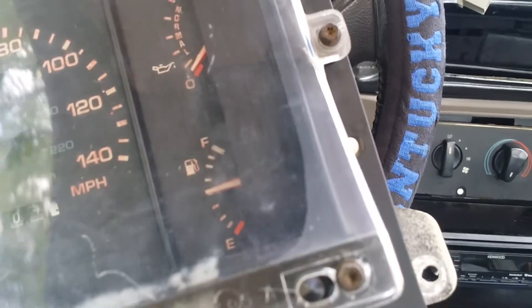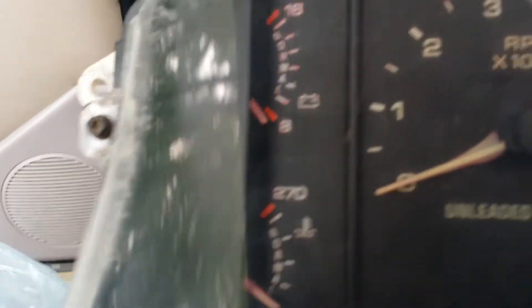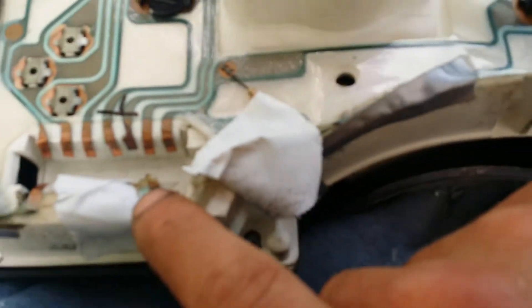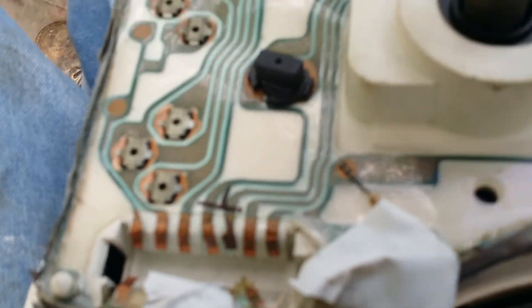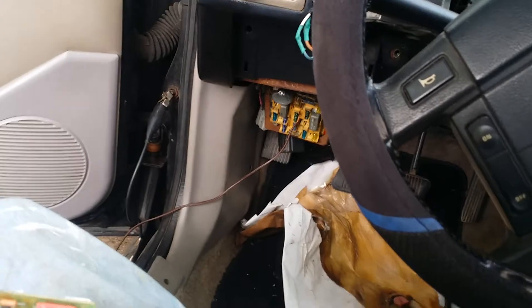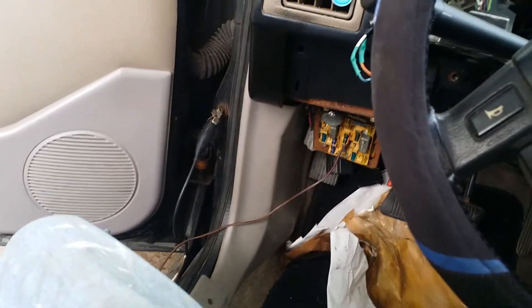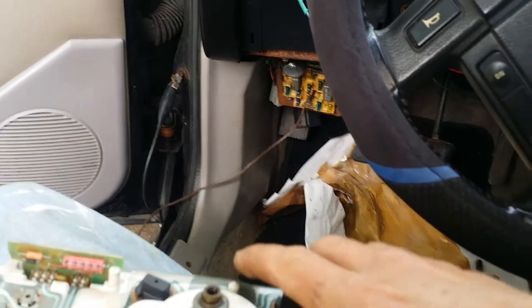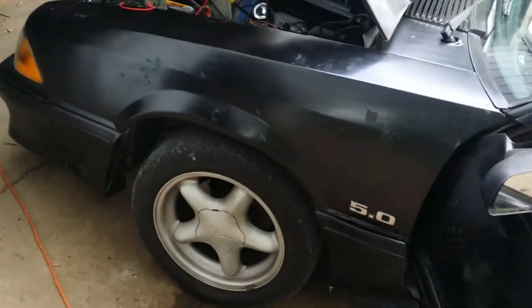It's got to be the green wire with the little red stripe, and it's on the side of your instrument cluster - like where the oil and gas gauges are. You'd think it would be on the other side but it's actually on this side. As you flip it over you can see this little thing here - guys tell me that's your regulator running down. I've got some bad places in here that I'm going to try to fix, and that may have been my problem altogether - why it wasn't looping back in itself. It's a bad design - it goes from the alternator up to here and back to the battery, makes a loop, and it's a little bitty wire that makes it hot.